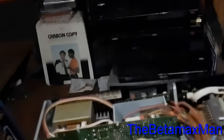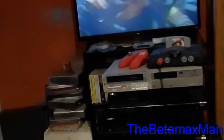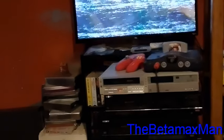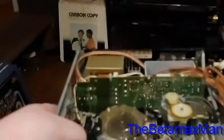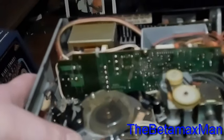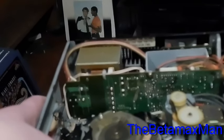I'm going to make sure there's no tape tension issue — just pull back on the tensioner and see if our problem goes away. The tensioner is fine, I think. Yeah, the tape tension is fine. Tape tension is okay. So we definitely have a drum problem.